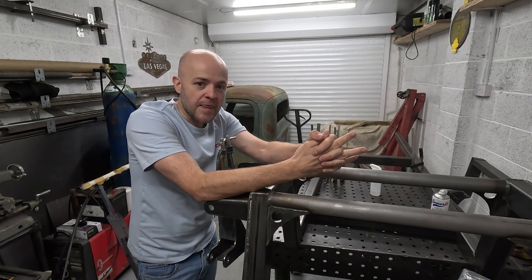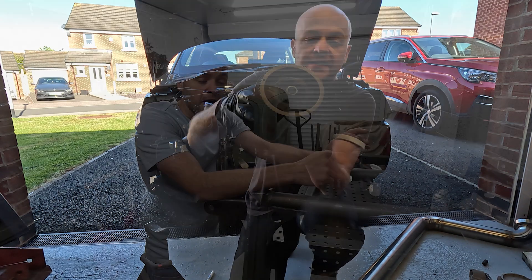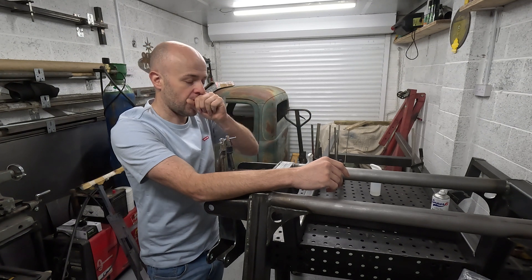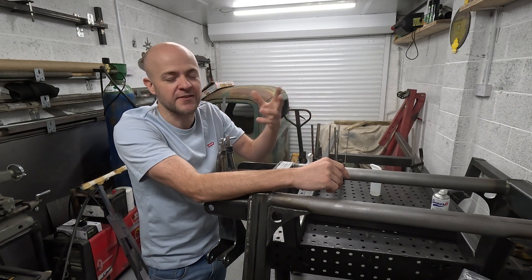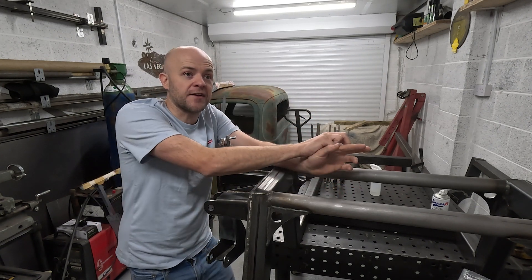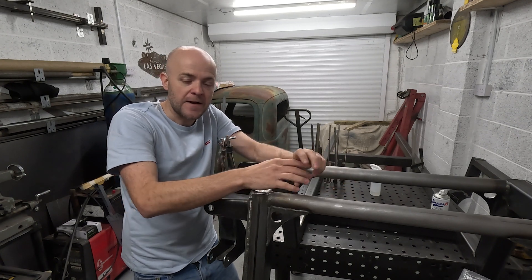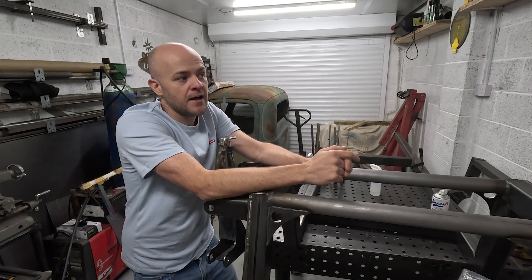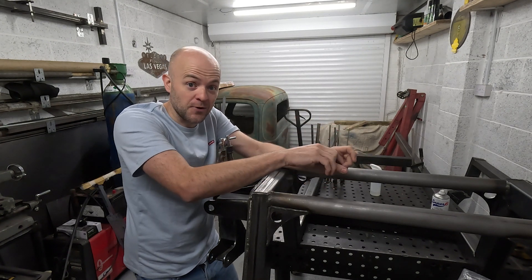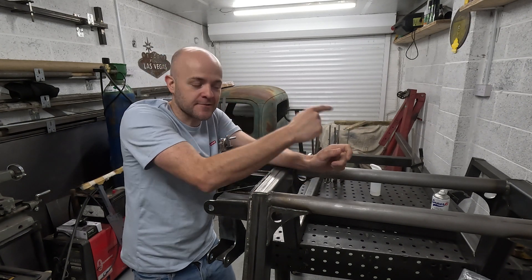For the power steering, I made a trigger wheel using the oil seal trigger wheel along with a sensor and a bracket, and remote mounted it because it was too small to fit on the crank itself. I mounted it to the unused AC pump position, and it gave me the rev counter. But the A1 was still too clever — I think it wasn't picking up a cam signal, so it would allow the rev counter to work which would allow power steering to work, but the rev counter was erratic, potentially interference, and it needed another signal. That would cut out the power steering and ignition after around a minute — enough to get me down the road before the power steering cut out. That was unsafe, so I brought the vehicle back.